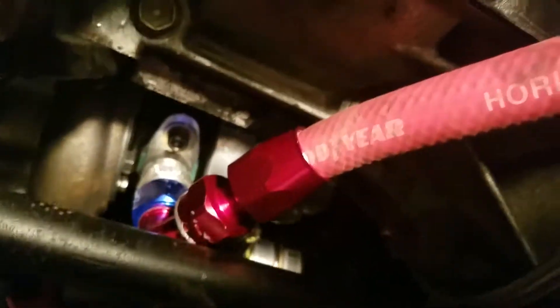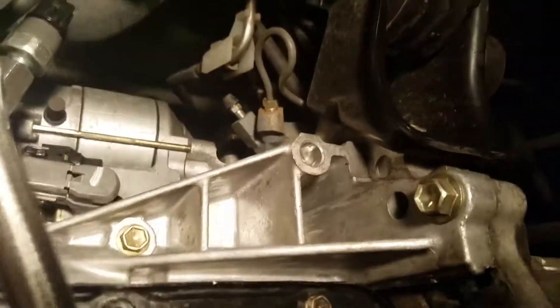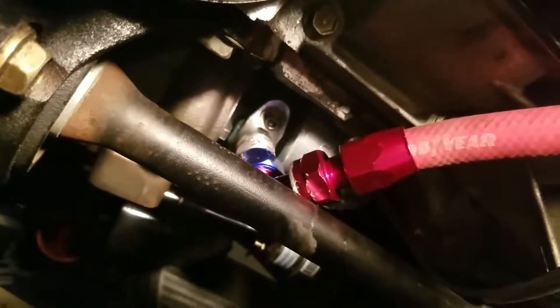I'm going to put all the bolts on. This is where the drain for the turbo is. It's gonna look a little kinked but it'll work — it's not damaged on the inside, and with the heat it'll probably stretch itself back out. He's working on the oil feed — just showing this braided line. Putting it on is way easier than taking it off — it's already probably halfway down.